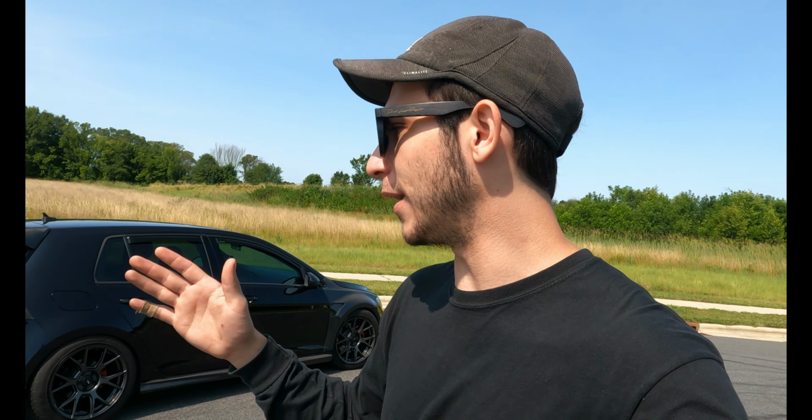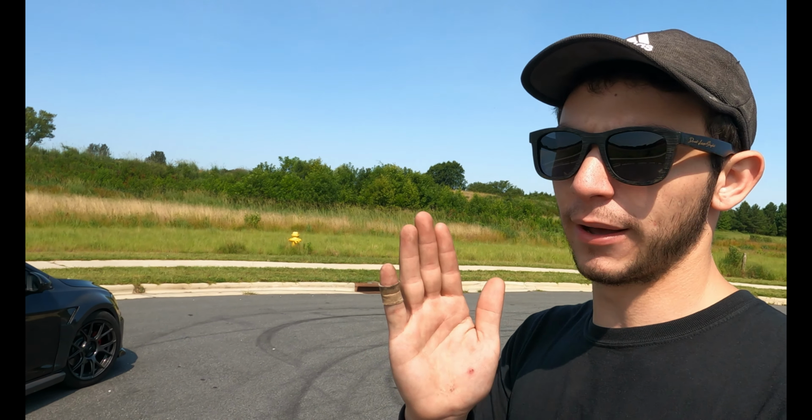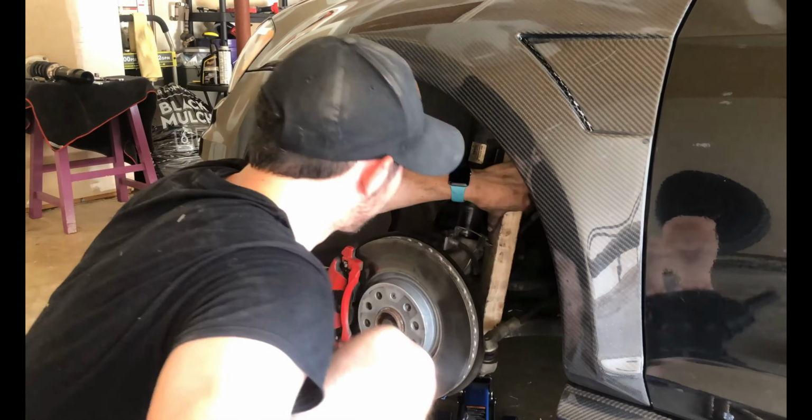So I ended up putting it directly into the bottom of that spring holder, and it was able to compress straight up, which made me feel a lot safer, and it honestly worked way better. Rather than making it all cockeyed and getting stuck whenever I did it off the spreader bolt. So I'd definitely recommend getting a 2x4 right up against the bottom of where that spring sits, compress it there, tap the knuckle with a hammer, and it's going to drop right out.